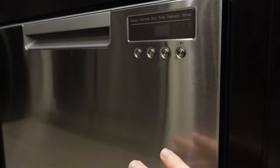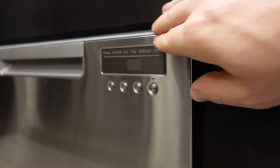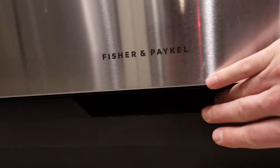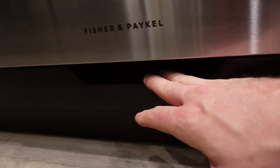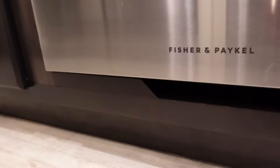I needed to clear 24 inches to get my Fisher Paykel in, and I did that by removing a single column off the right side of the opening. Technically the dishwasher is not perfectly centered under the sink, but you really don't notice it. As for height, the Fisher Paykel is 16 and one-eighth inches tall while the Jayco opening was 17 and a quarter inches — sized for the Vesta. My solution was to raise the height of the dishwasher from the bottom using spare trim pieces from the removed cabinet door, leaving the center open with 45-degree angle cuts for ventilation and to allow any leaks to be visible.